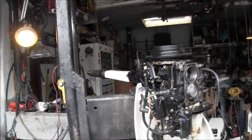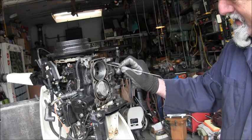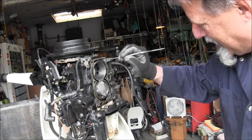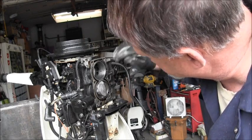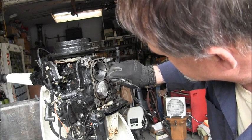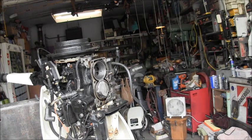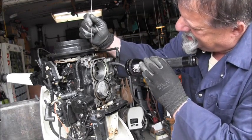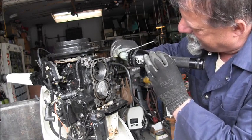So the cylinder part actually honed up pretty good. But wow. I don't know how far deep down them cracks go. I don't see any crack through the ports there on the exhaust ports on the inner side of that. So I'm guessing they run down into a couple inches or so down in there. It's hard for me to tell, but boy, they're busted all to pieces.